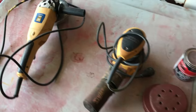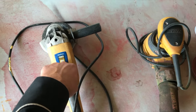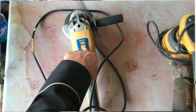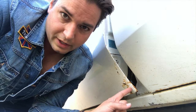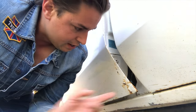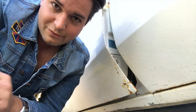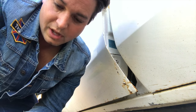This should be enough to get us started, but first we're going with the grinder. I'm going to get my safety glasses on so I don't get a chunk of metal in my eye, and then I'm going to grind out that rust. If there's one thing I know for sure, it's that when you see a spot like this on your car it's probably going to end up being a pretty big hole. It doesn't look that bad right now but this metal is all soft and has to go. It's going to look pretty bad for a little while, but don't fret — that's what you have to do before you're ready to fill.